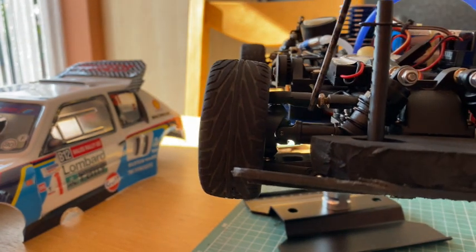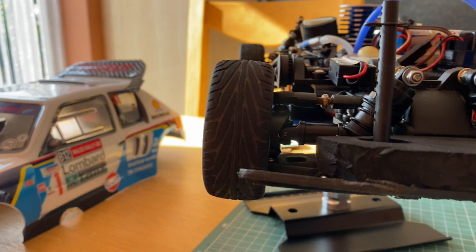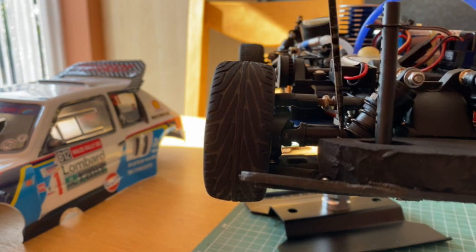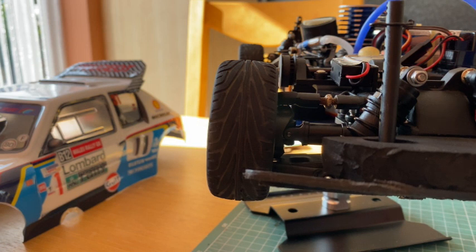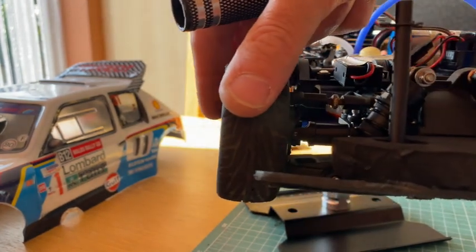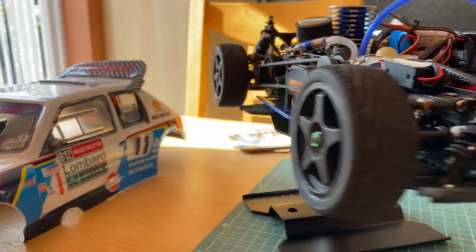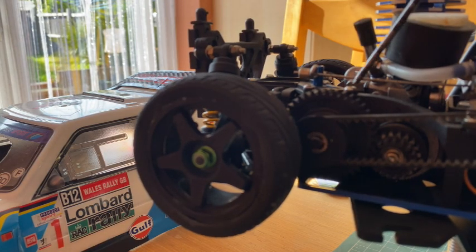This is the drive shaft I replaced. It would go in but the bearing wouldn't sit flush inside the hub. Over time that put a lot of pressure on it and snapped the UJ. I think they tried to drill out the inner part of the hub recess where the bearing sits but made a complete cock-up of that. I've smoothed it off, cleared the residue, and got the bearing in - shaft's on now, no movement, all good.